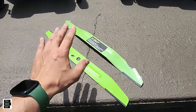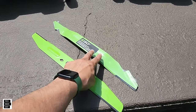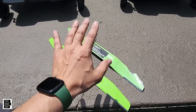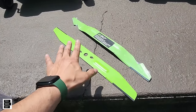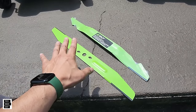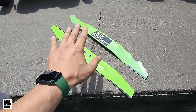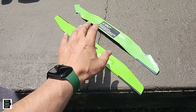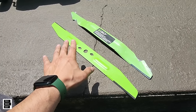Let's get into the extended run time blade. Here's your upper blade paired with the extended run time blade — you can get this as a set, it's AB 2100D (link in the description). What does this do? It balances run time and quality. It's used for daily cutting of about a half inch or less. Pros: it doesn't use much battery and offers a pretty nice cut, though you need to keep it sharp and it's not for long blades of grass. Cons: it will not mulch — mulch sizes will be larger due to the blade design, so make sure you mow often.